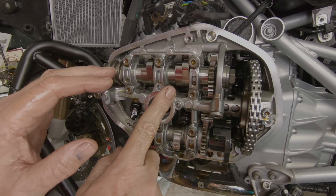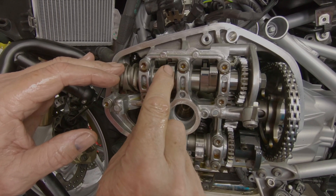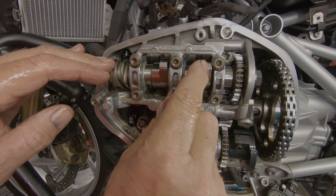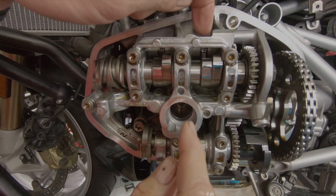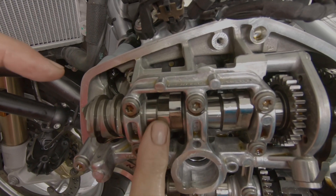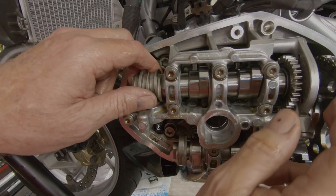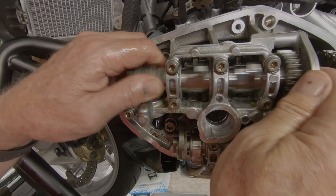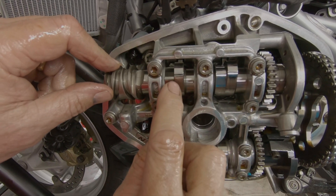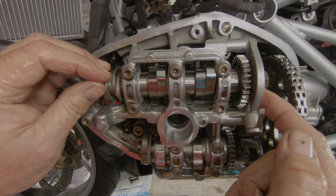With the engine at top dead center, the intake cam is on the base circle for both the high-performance profile cam and the low-performance low-profile cam. Looking straight on, you can see that the cam follower pickup is in line with the low-profile cam on both lobes in the top dead center position. This camshaft can change from low profile to high profile — now the follower is in line with the high-profile lobe of both of them. It's easy to shift back and forth.